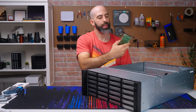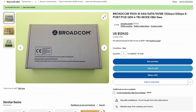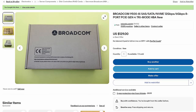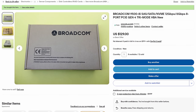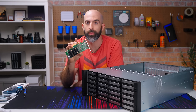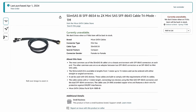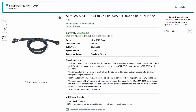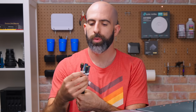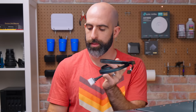So I went ahead and bought a 9500-series card, which is PCIe 4.0 and is tri-mode — though I don't really need the tri-mode features. All I needed was PCIe Gen 4.0. It uses a single cable, so I had to buy a cable that goes from one Slim SAS connection to dual mini SAS connections. Backplane to HBA — cool stuff.